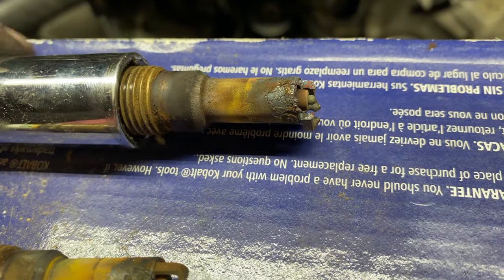Dustin came up with a pretty ingenious solution — he's taking a tube and putting it around the end of the new spark plug so you don't drop it. People will sometimes just sit them up at the top and let them drop down on the threads, which can mess up your gap. Since these are pre-gapped plugs, any bending of the electrodes will definitely mess them up. So he's dropping it down in there, twisting the tube, and it allows him to thread it in and get started. That's just a quick little tip for you guys — we're trying to make this as informational as possible.